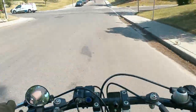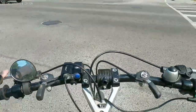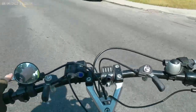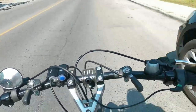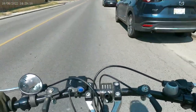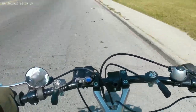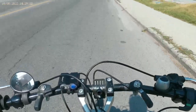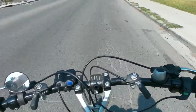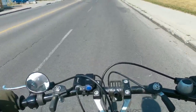But after 6 years, I think it's time to break down and buy a hub motor bike. I couldn't afford a mid-drive and I know it puts wear and tear on the regular freewheel that a lot of people don't understand. It can just shred one of those if you're not careful with shifting gears, etc. So I decided to go with the rear wheel drive hub motor.